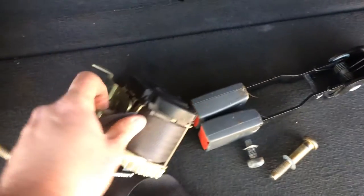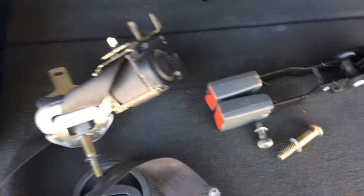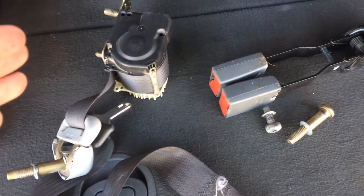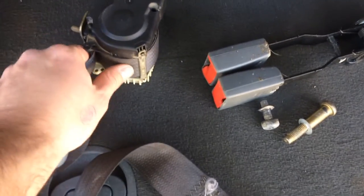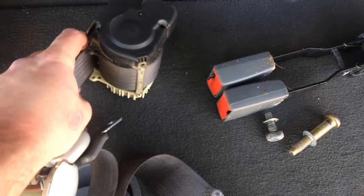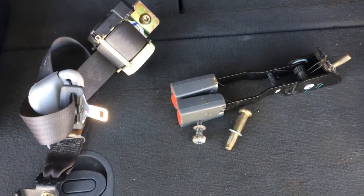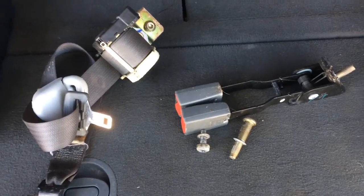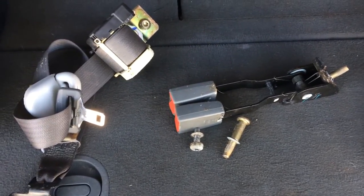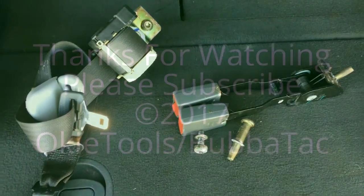Another thing you need to be aware of: as you can tell right there, it's locked up — but that's no big deal. When these go all the way in like that, they do get locked out. There's a trick to that: just hold it in the vertical position like it would be installed, then gradually pull it out, give it some slack, let it loose, and it'll eventually let loose on you. So no big deal if those lock up on you. That's everything I got, and I didn't have to pay a whole lot for it. Going to the junkyard can save you a lot of money, and in this particular case it puts these seatbelts back into commission. Thanks for watching.